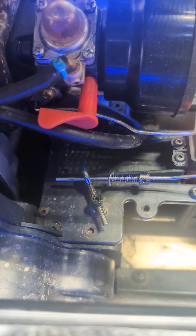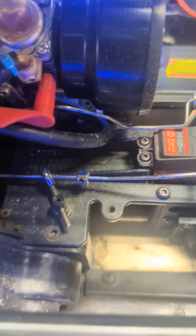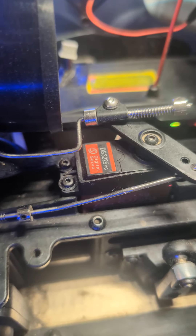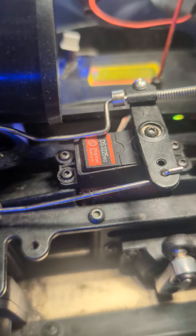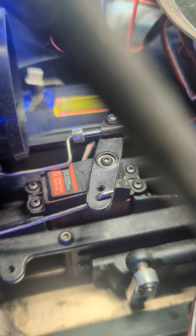See when you go forward, the rod's not coming out. When you go to brake, it's right there. Same thing with your throttle — you can watch right here, that pushes your throttle. And then the other spring allows you to go to brake but still holds that at an idle.